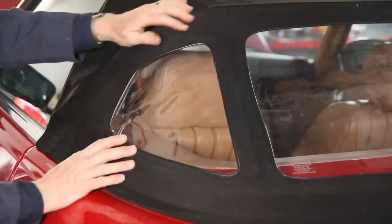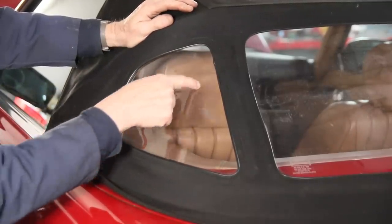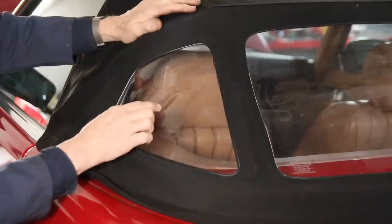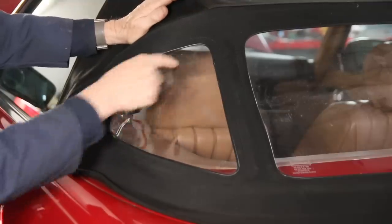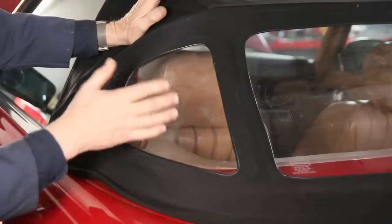These quarter windows tend to suffer the worst. They get a real bad crease right in here and they usually get bunched up when the top goes down and folds. It usually bunches this together, so you're going to get some problem right in here. This is the hardest area to repair — I'm going to show you in a second what I mean by repair.